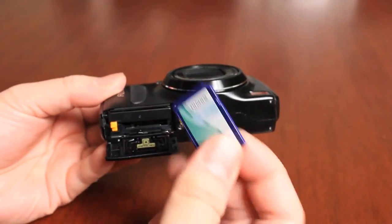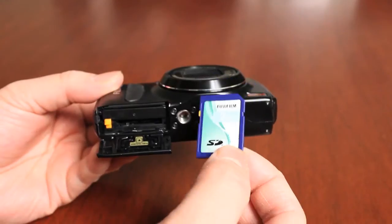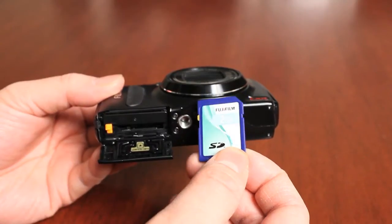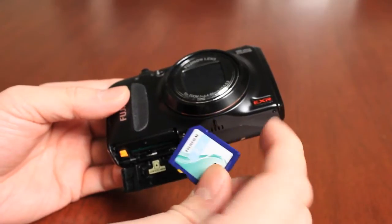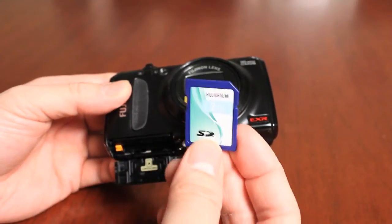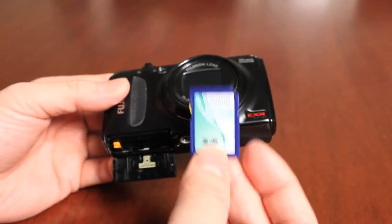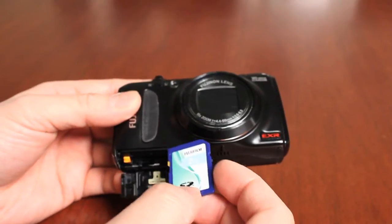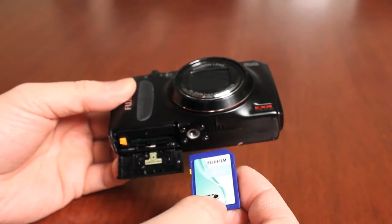The second thing to do is insert your memory card. I have a standard 2GB SD card here. The camera accepts SDHC cards as well as the newer SDXC cards, which have capacities higher than 32GB. If you plan to record HD video — this camera records 1080p full HD with stereo sound — we highly recommend a class 6 card or higher. The card needs to be fast enough for the camera to write to, otherwise recording will be interrupted. If your video stops around 10 to 20 seconds, you don't have a fast enough card.